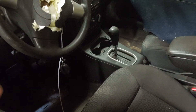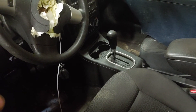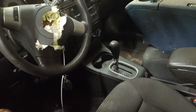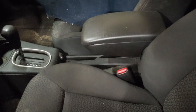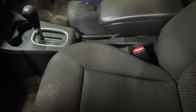This is why I wanted a test-buck car for this — I'm going to have to do some major hacking on that floor. When I cut a piece out I'm not going to throw it away; I'll keep it around because I might have to cut a piece off the piece I cut and weld it back on to get all the contours right. Where the engine sits is going to be partially dictated by where the shifter comes up through the floor — I'm going to make sure that's comfortable. And I've got a bad feeling the transfer case is going to come up right about here. Maybe I could put a little hump in the floor under the seat between the legs and gain another inch that way.